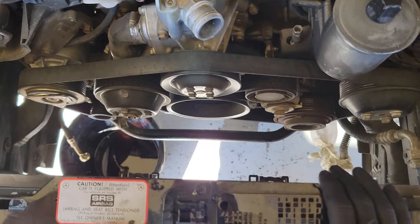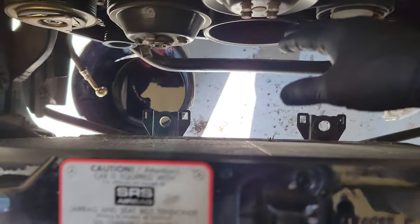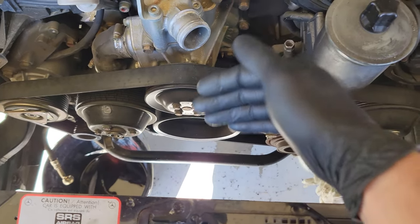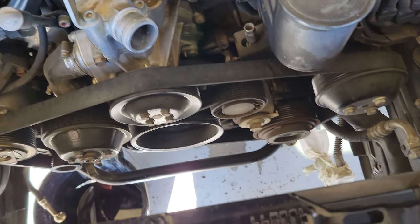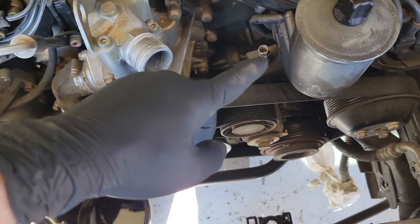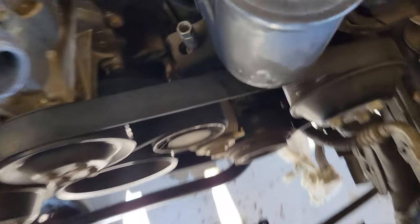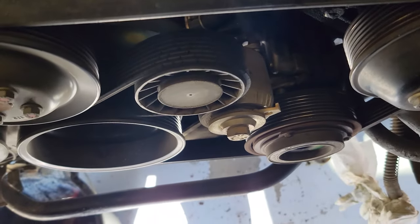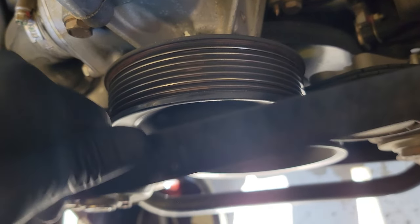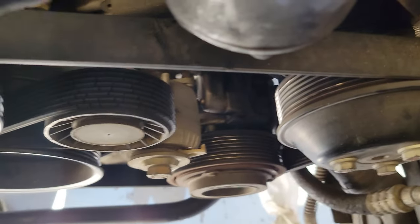You can see how much more room there is up front now — about six inches between the condenser and the engine, which will give us a lot more room when pulling the engine forward. I just noticed it looks like the tensioner isn't tensioning properly. There's an adjustment right there, but checking it now — pulling up on the belt, there doesn't seem to be very much spring. I can actually pull the belt off the pulley, which I shouldn't be able to do.